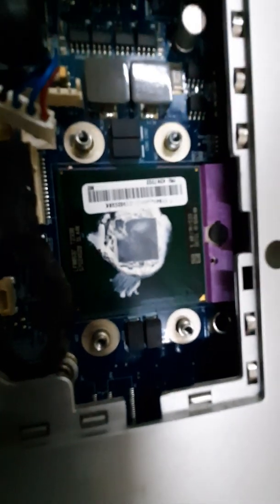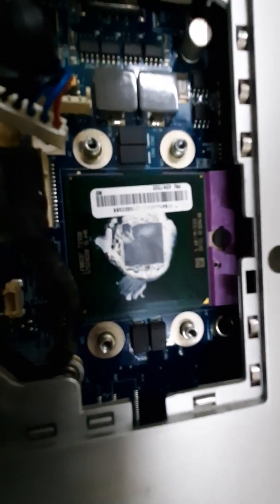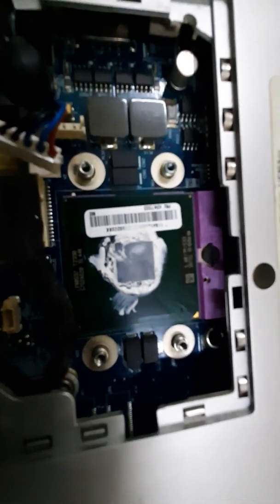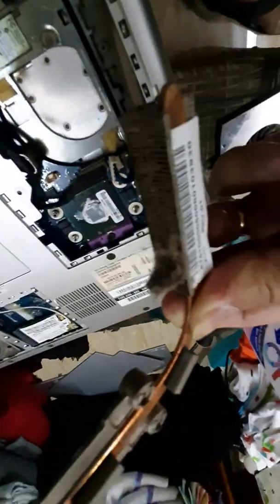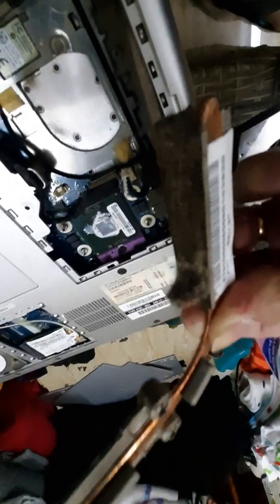This is the T2330 CPU, dual core at 1.60 GHz. I am planning to replace this one with a T8300, so I'm just reading the parts. The heatsink is still good and not dry yet, so what we will do is just clean this one.